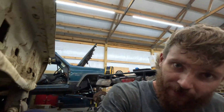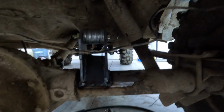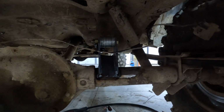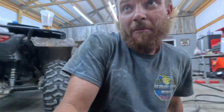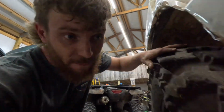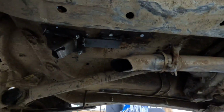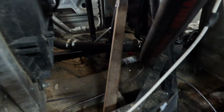Alright guys and gals, I don't know how good you can see it in here, but we got that bracket on. We got to weld it out, put a little gusset on the inside of her. I'm sure y'all are gonna say, well, it's ugly. Hey, I'm going for it to work, not for it to look. Like you can see that one up there, she's crooked. But hey, do you think anything else on this Jeep is straight? Probably not. But I took and welded that bracket to a piece of flat plate, and I tied it into my cage mount. Yeah, that was an afterthought, and it looks like crap, but I don't care. And then I bolted that plate to another 1/4 inch plate right there. And then I made that gusset from there. Up there it's welded on the front, and that square tubing kicks from there to up there on the cage.